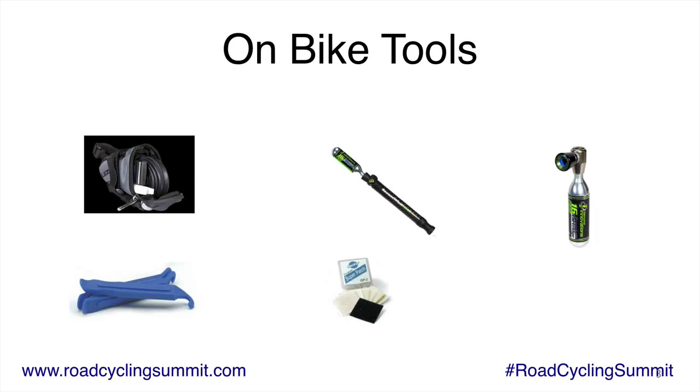One note on these air inflation devices, I pictured here these little CO2 cartridges. And I personally like those. But there's a downside. The nice thing about the CO2s is they fill the tire up. It doesn't take a lot of effort. The bad thing is, once you use up the air that's in there, you're done. You don't have any more air. And two, it's hard to regulate the speed at which the air goes in. And that can cause trouble. In the middle of the screen there, you see sort of a pump CO2 combo.